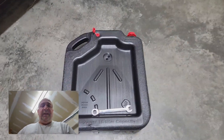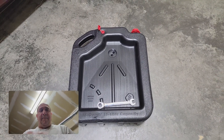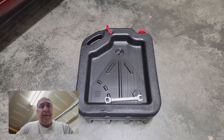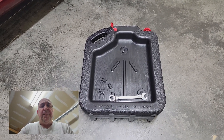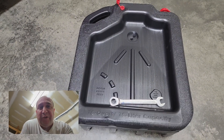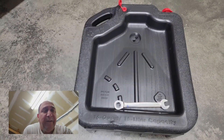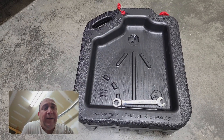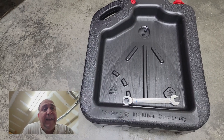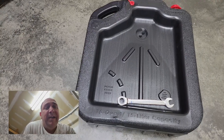As you can see, I have my can to catch oil and my wrench — it's a 15 millimeter wrench for this car, same as my other Mustangs. The oil pan on this one is a little different; it shoots from the side versus the center. This is pretty much all you're going to need to go under the car right now — the wrench, the catch can, and a couple of paper towels because you're probably going to make a little bit of a mess. Make sure you have the oil cap off because if you try to fill it without displacement, it won't fill properly.